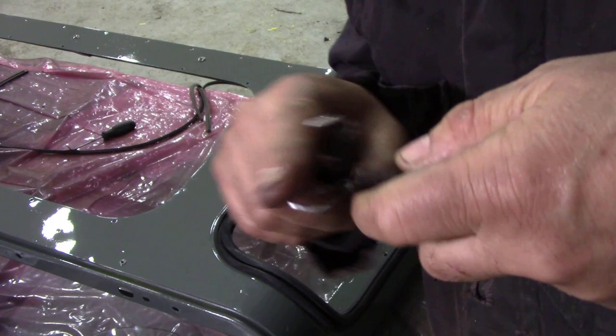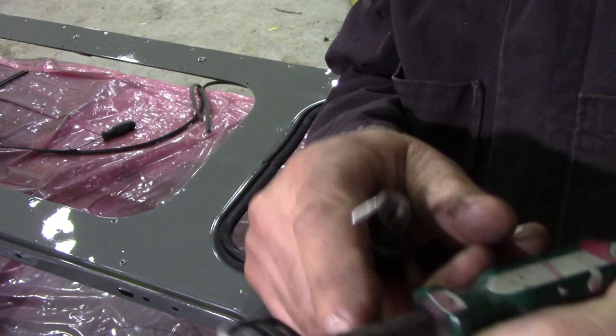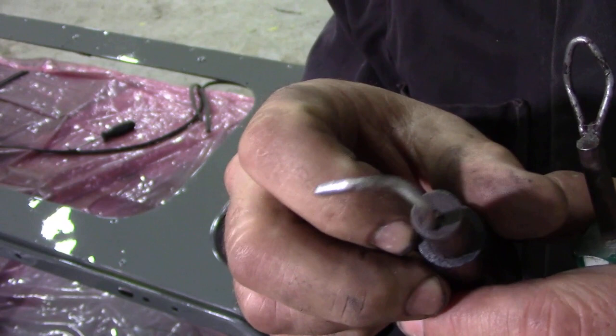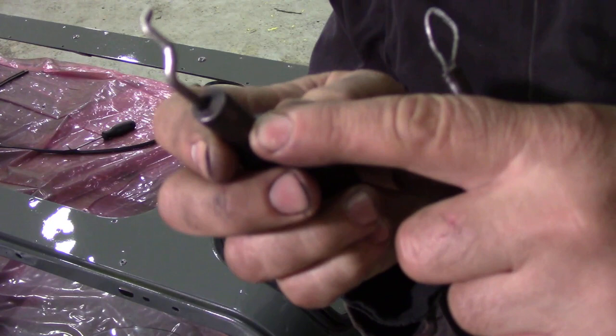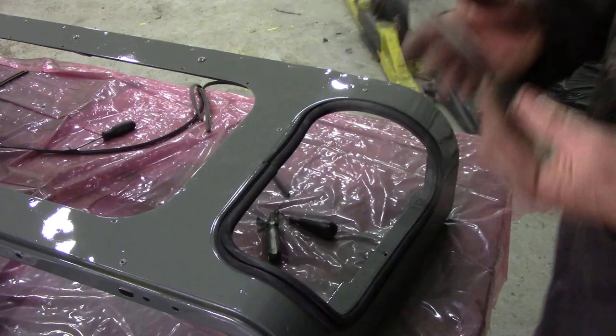The tools you can actually buy commercially, but this one was an old screwdriver and it's got a dog leg shape. The reason for that is so you can get your fingers underneath — if it was flat you'd be rubbing against the rubber. It started off as a ring and I just bent it, nipped it, and welded it onto a screwdriver. You could do exactly the same with this little hooky thing. It's a special shape but there's nothing to stop you making it. This is the original tool — you could undo the grub screw and change the bits, but I've lost them over the years.